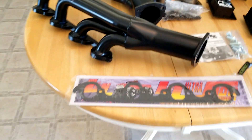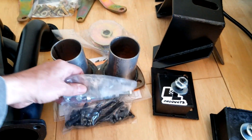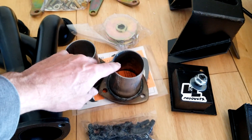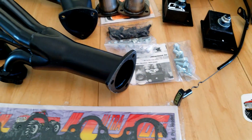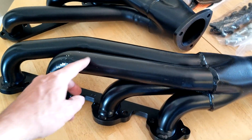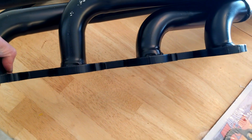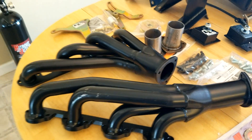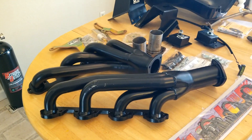It comes with header gaskets and three inch collectors. Collector gaskets are here — actually that looks like two and a half, but the collectors are three inch. Looks like inch and three quarter primaries. And the flanges are impressive — I measured them and they're actually half inch flanges, which I've never even seen before. Certainly better than the cheap ones that break and warp and cause problems.